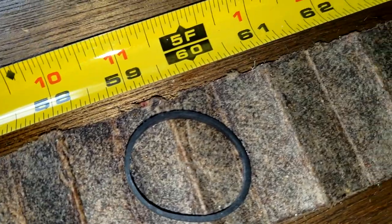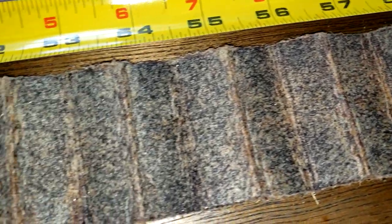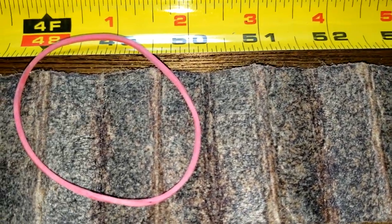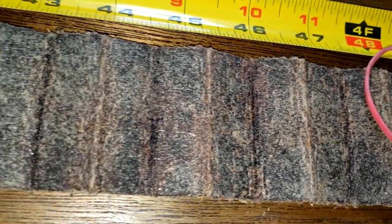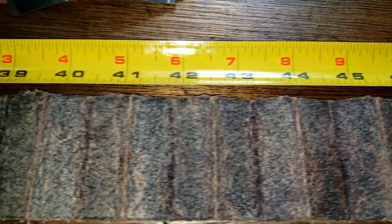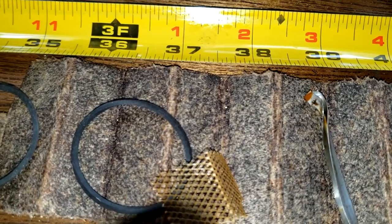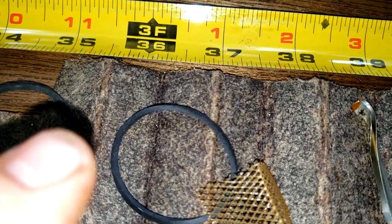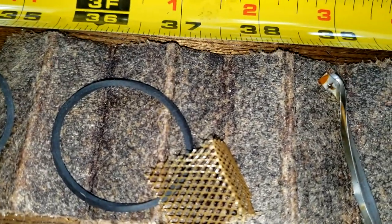There's a few throughout. But there's no soot on this oil filter. It's clean that way. But it does have a few sparkles to it. And as you can see, some of them are metallic because that magnet got one. There, you can see one. You can see one there. You can see one up there. Yeah, let's look at the rest of the filter.